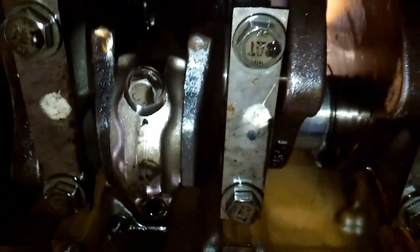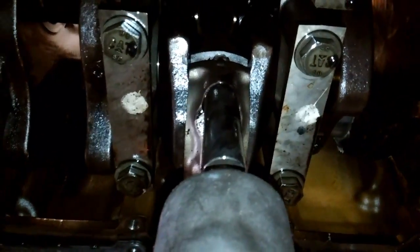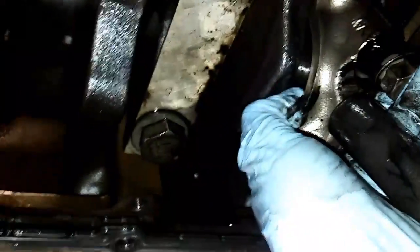We have your number two and number five connecting rods here, and that is your connecting rod cap. I do them in sets of two because your crank throws are in pairs. I've already removed the connecting rod for cylinder number two; we're going to remove the bolts for number five. Just remove it and the connecting rod cap should come off. You're going to want to keep these in order — they should have numbers on them already; if they don't, I suggest engraving them or writing with a paint pen.